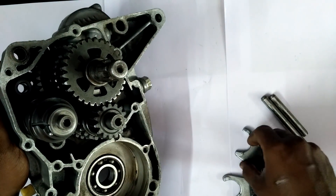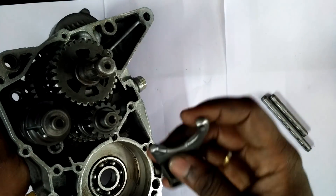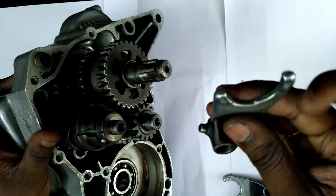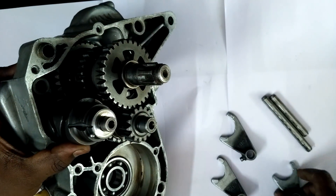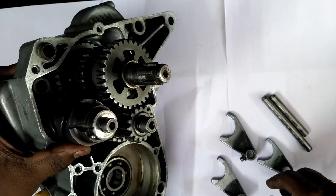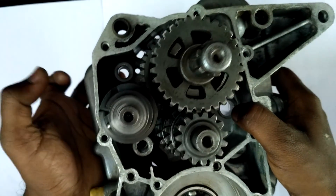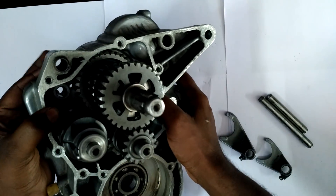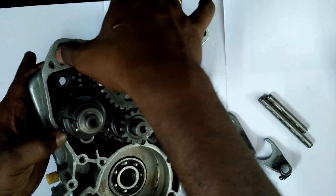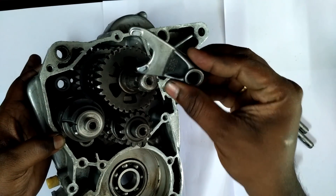There is not enough room to move around and put them in separately. Next, the shifter drum goes in. Once the shifter drum is in, the gear forks go in. Generally, if you see a big gear fork it will sit in the big gear dog, so using the size you can pretty much determine which goes where. If you can see the distance from the pin, that hole is where the pin will go for the fork shifter.